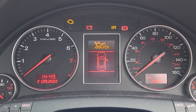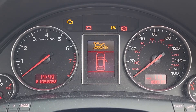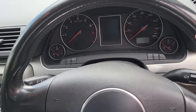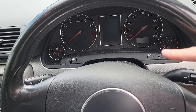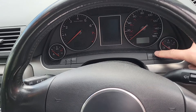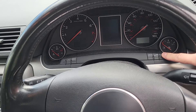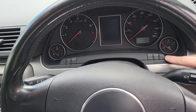There is a process to do this and I will talk you through it so that you can do it after you've serviced your own car. The process involves these two buttons — the service button and the zeroing button — and the ignition. While holding the spanner button down, we turn the ignition on, and then press reset using the button with the zero.